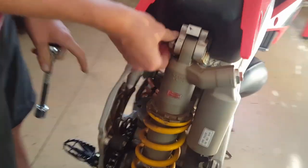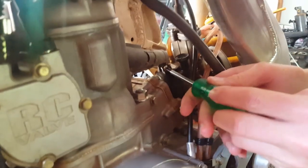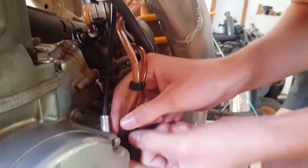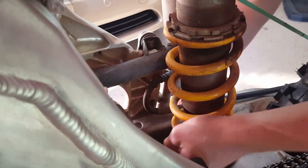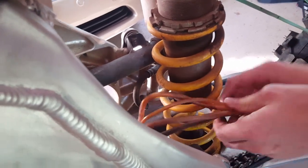Make sure not to get any dust in the carburetor because it's right there. Now you want to remove the front carburetor clamp that goes to the engine, and then pull out the lines. Watch out — they're usually pretty fragile when they're like 15 years old, and there are ones in the back also which are the overflow tubes. This one has a zip tie on it, which makes it a little easier. Then you can simply pull the carb off.